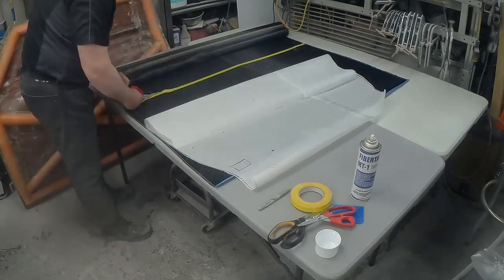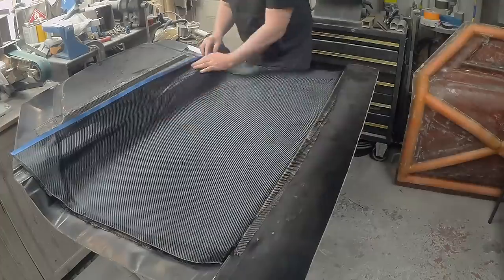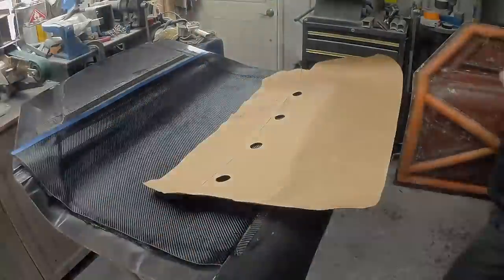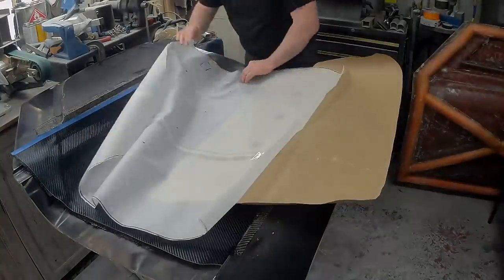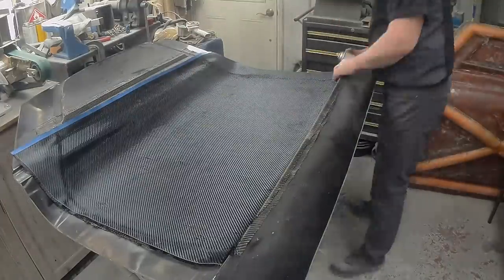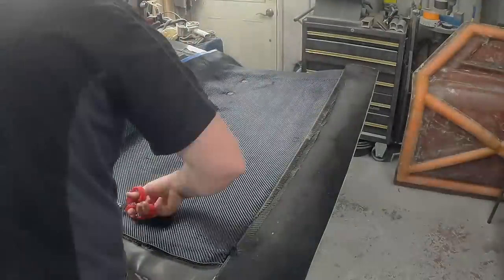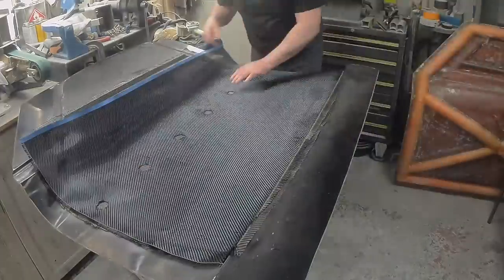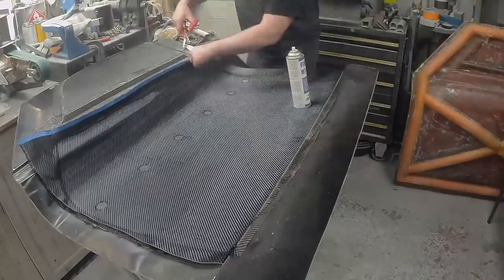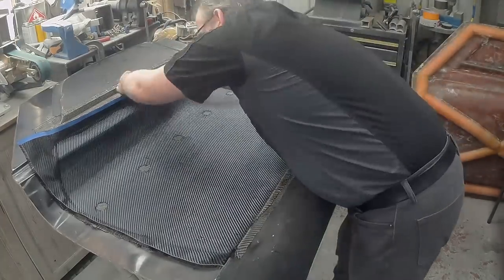Kevlar is a little bit weird to work with. I only need it on the bottom side of the door skin, and tape would not stick to it — I tried every kind I have. I'm carefully checking where I'm putting the pattern, using a paint marker to mark it off. A little dust of glue holds the fabric together while cutting. I cut out around each trim screw hole and around the door handle area, and keep it away from the edges where I have a material thickness target to hit.